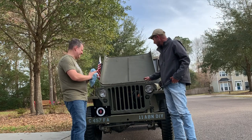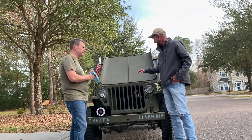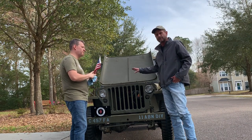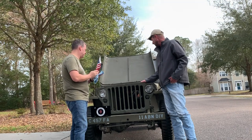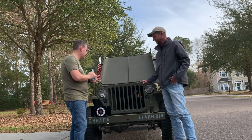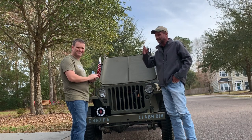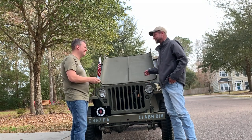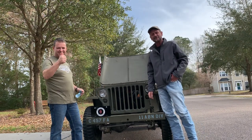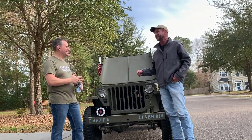So I'm here with Janton — we changed out the head gasket and everything seems to be okay. There was a lot of coolant in the exhaust system and white smoke everywhere, but it seems it's not pumping out coolant like it was anymore. It's going to smoke for a while until it gets out of the system, but I'd call that a success. Janton's got a funky Solex carburetor setup they'll remedy someday — he inherited that. Sounds good. Signing off — Team G503, Scott Schiller with Janton's Jeep. Welcome to the club.